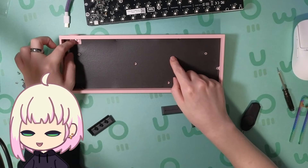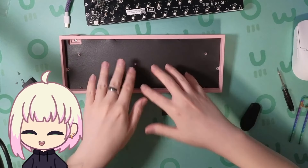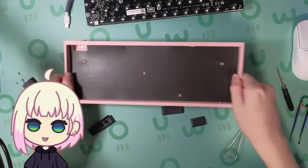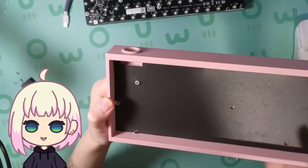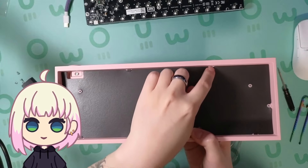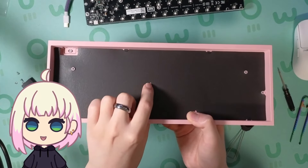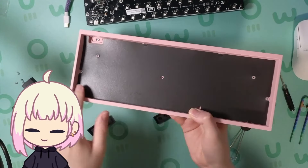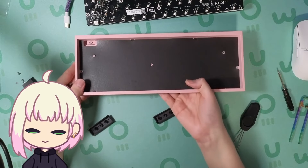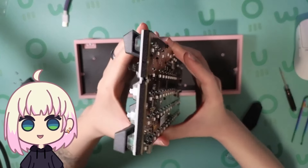Now let's talk about the case. This is the foam provided with the Tofu. I'm not using the Wooting foam, because I found that the foam provided with the Wooting tends to actually accentuate a lot of the spring noise in this particular build. So I ended up going with this one — it's still very plush, but it is much thinner. I do have those mounting hole sleeves, and I also use the included dampening bits, which are much thinner foam on the resting points. There's no standoff — just here at the edges — which keeps things sounding mostly uniform.